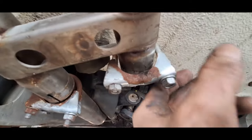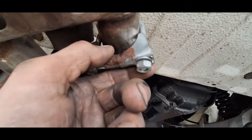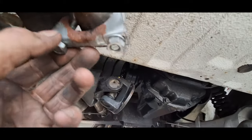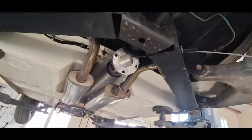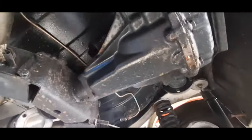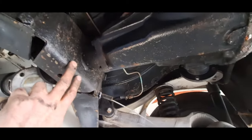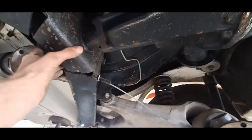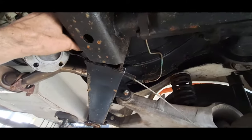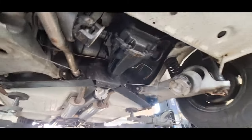Another little tip: I put a washer under the nut on the exhaust clamps there - that allows you to tighten them up a little bit easier without it deflecting and destroying the clamps. As you can see, they're in mild steel so they're not particularly good. Next step: get the bolts out, get the transmission jack under it. I'm going to try and split it from the quill shaft first, and I think I'll change the quill shaft bearing if possible - though I've never actually done one before. I may just check it for play because it really does feel like it's not worth touching.